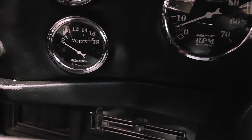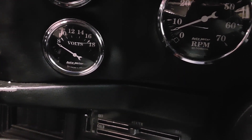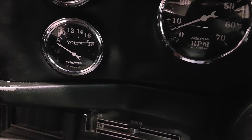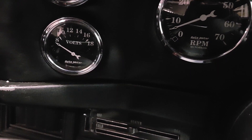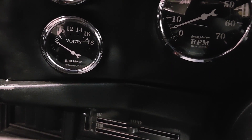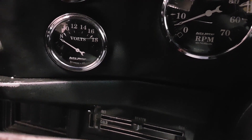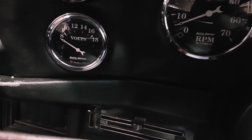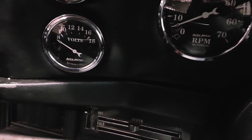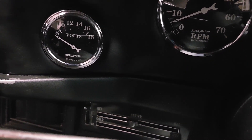Something to add: the choke was on when I started the engine, so the RPMs went up to about 800. When I turned the engine off and restarted it warm, the choke was off and it started at about 600 RPM and the alternator didn't start charging at that level. So it does need some RPM above idle to start — that's obviously where the three-wire would come into effect, because that would start the alternator as soon as the engine started regardless of RPM. Set up as a one-wire, it seems to need around 700–800 RPM. I'm not too worried — it's easy enough to blip the throttle, and most of the time the choke will be on and you'll reach that RPM driving anyway. It would be more of a concern if it needed say 1,500 RPM.